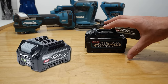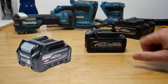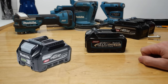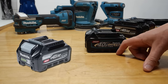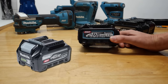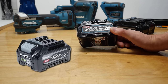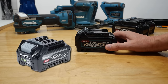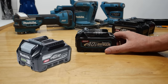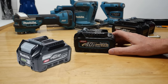It's not much lighter, but it is quite a bit shorter — close to 30% shorter, so about two-thirds the height. So how are they doing that? They can't be using 18650 cells because they haven't got 17 millimeters of spare space inside the current shell — that would be silly. So they must be using different tech, and if they're not using cylindrical cells, what are they most likely using in the new 2.5 amp hour F battery? It has to be pouch cells, doesn't it?